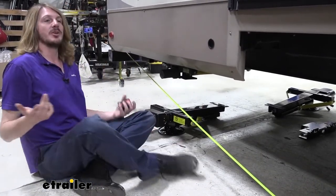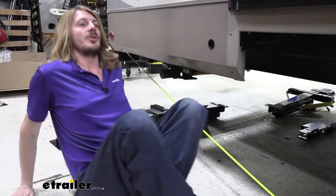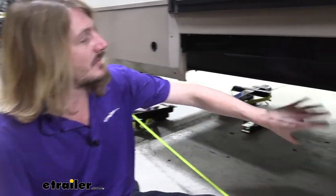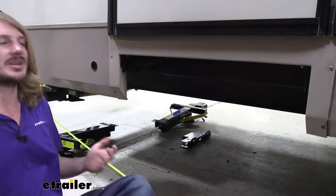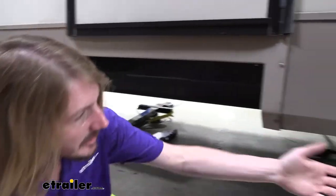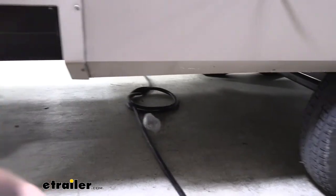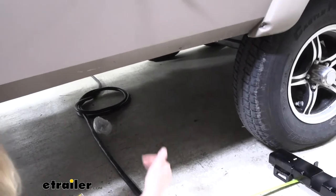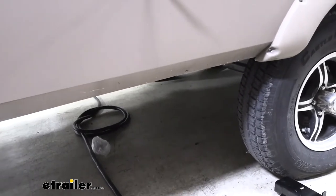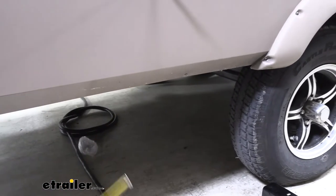We're checking the departure angle first because when you install your system for the rear, it needs to be within 18 and 48 inches from the leaf spring hanger located there. And when we measure that, you can also do it from the tire. The rear of the tire is also very close because the type of suspension system we've got on here actually doesn't have leaf springs.